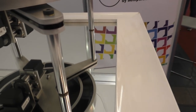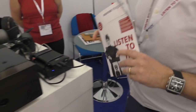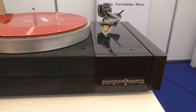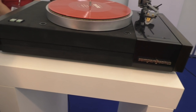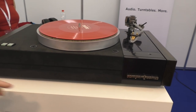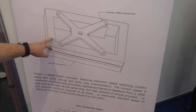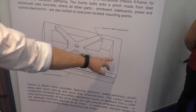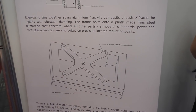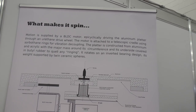The plinth is made from reinforced cast concrete — we need some reasonable thickness on the wall all around. There's a metallic structure inside to reinforce and provide mounting points. The sideboards, the frame, the electronics — everything attaches there. The platter is aluminum, but there's a ring of acrylic inserted all around to break vibration and resonances, and there's thick rubber in this part as well.